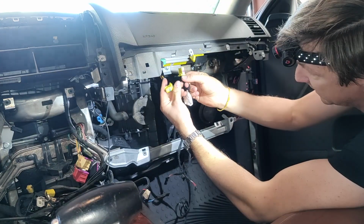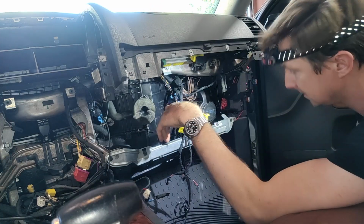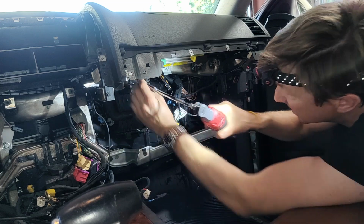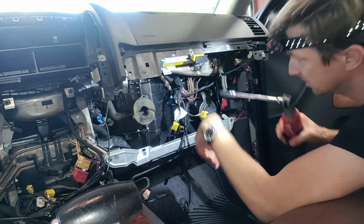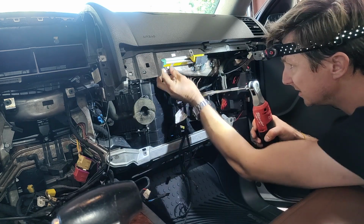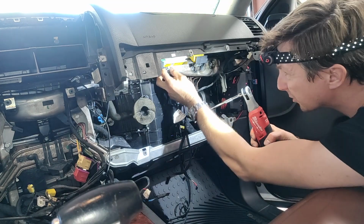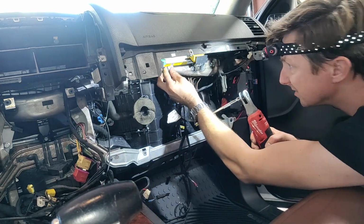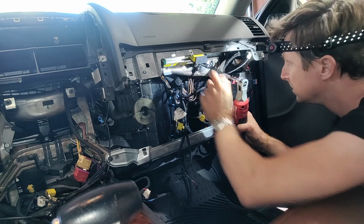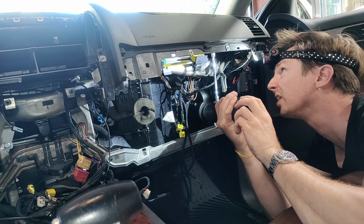And they also only go in one way. I have the purple on the right and the green on the left. And so we set those wires out of the way. And then let's go ahead and take out some bolts. Here are our 10mm brass bolts, or gold color bolts. I don't know if I'll be able to get the one here out easily. Yep, I actually spoke too soon. Not a problem getting that one out, but it's kind of in the way, so you might not have the right tool. So start it and then get the rest of it by hand. Take this guy. Take out three of those, and then we have four 10mm from the underside lifting up.